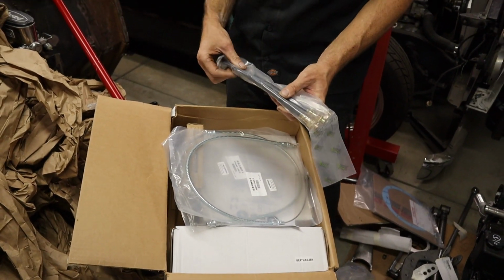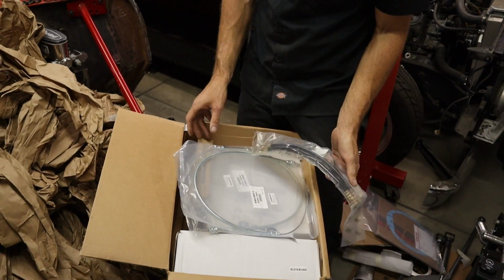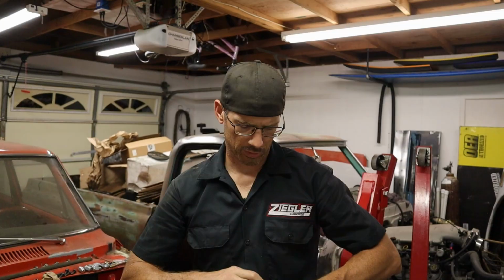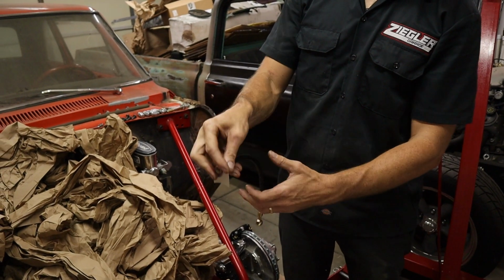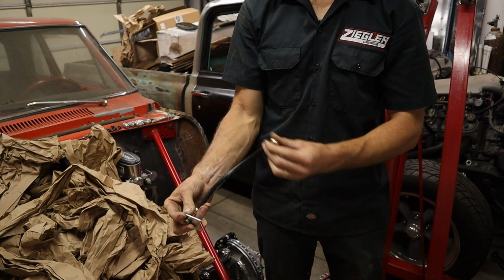So it comes with brake lines. These brake lines go from the caliper to the hard line on the rear end. So there's tabs you have to weld onto the rear end. Got these 2 tabs right here. These go onto the rear end housing, because if you hard line to your caliper, you're never gonna get it off the rear end without ganking your brake line. This goes to the caliper side. Put this on the rear end somewhere out of the way. Weld that on. Then you have slack to get your caliper off to change your brake pads. So that's pretty much the whole rear suspension.